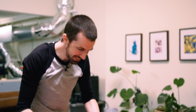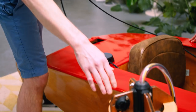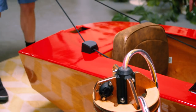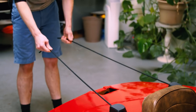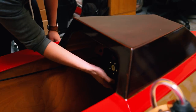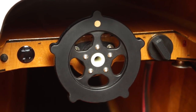For steering, it's old-school go-kart steering. These two ropes wrap around this drum and are attached with quick cleat connectors. You spin the wheel one way and the shaft pulls — go ahead and spin it. It takes about three rotations to go lock to lock. That is so analog, and it's amazing how effective it is — so simple.